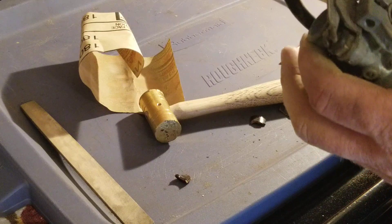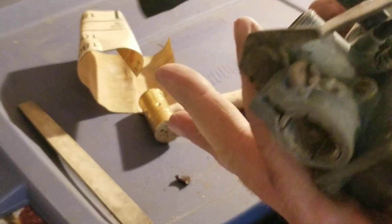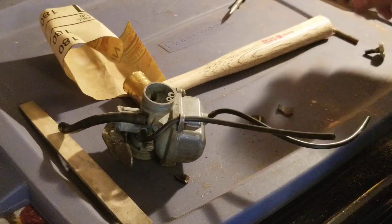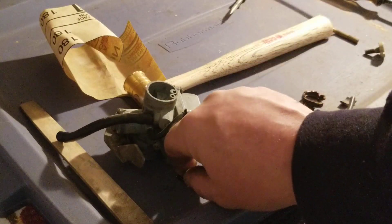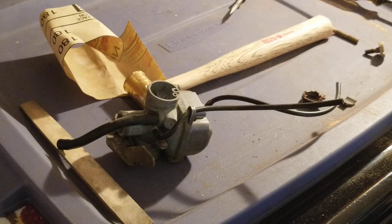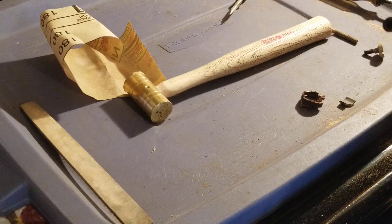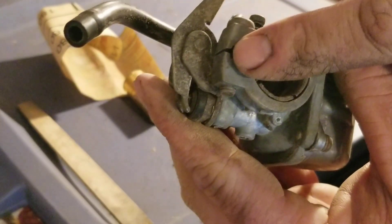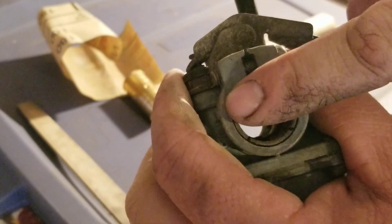Put the bolt back in and now this carburetor right here is ready for installation. We replaced the broken insulator - it was a tedious process, takes about 20 to 25 minutes. These are very hard to find online so get the proper ones if you can. If yours is broken, you can always get another carburetor and see if you can extract it from there - I've had pretty good luck doing that. Then open up your gap here using a screwdriver, tapping it down to expand it so when it does tighten up it'll be nice and tight.